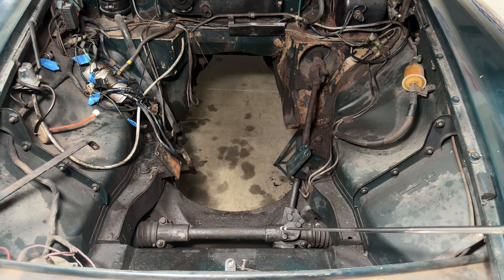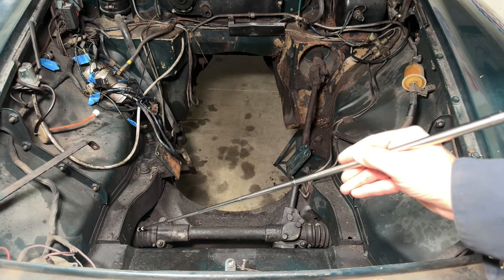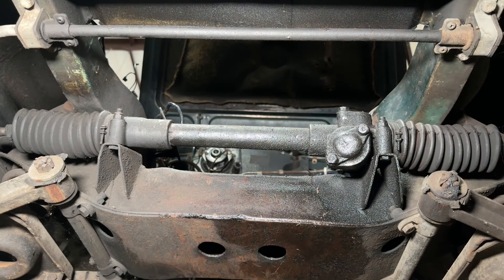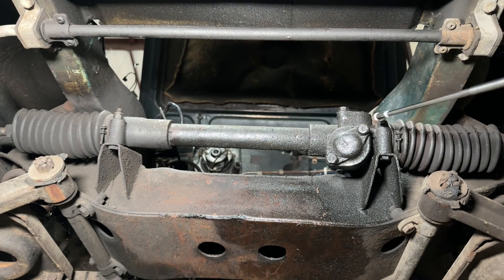Inside, there is a rack and there is a pinion. That pinion gear rotates and moves the rack, extending the tie rod on the passenger side and contracting the tie rod on the driver's side. Let's go underneath the car and see what that's connected to and how it actually activates the steering. Here's a great view underneath the car. This structure right here is the front suspension cross-member, attached by four bolts to the frame rails. This is the driver's side frame rail, and this is the passenger side frame rail. Right here is the rack and pinion setup integral to the steering of the car.